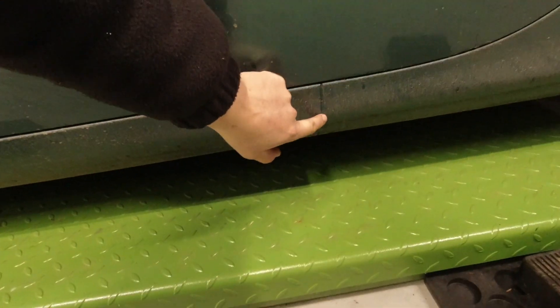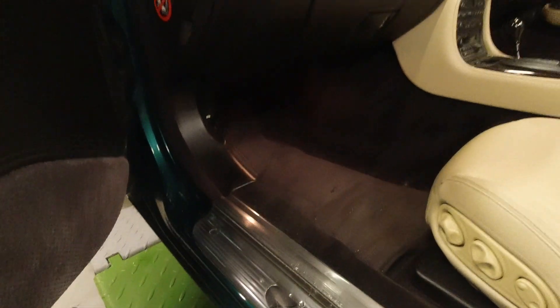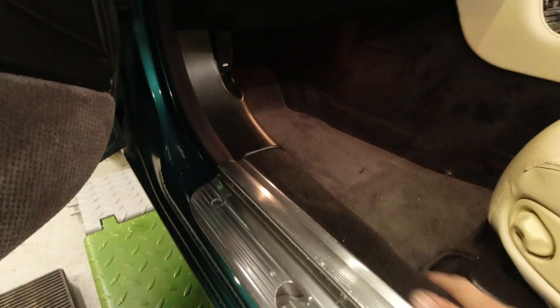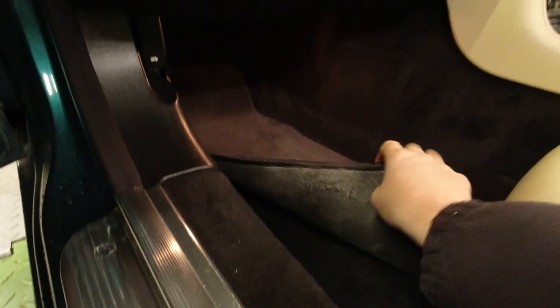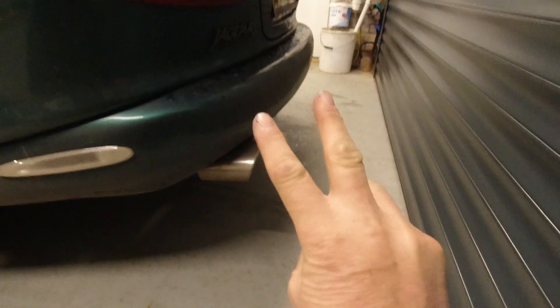On the sills there is a seam. You can get rust around there, or some cars have that seam missing - that means it's either been dressed in a body shop to a very high standard, or it may be a sign that somebody's covering up rust. While it's not rust I'm talking about here, always check this area for being wet and look underneath your floor mats at the base of the sill, because seals and drainage channels fail, dump their water here, and once wet it soaks into the sound deadening and can rot out the floor wells.